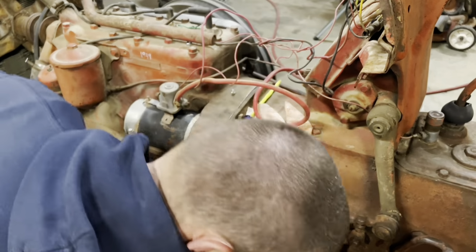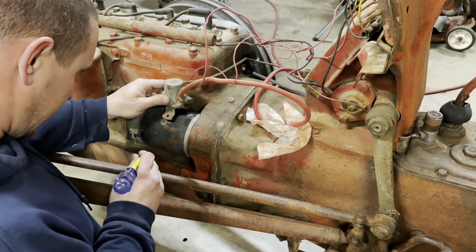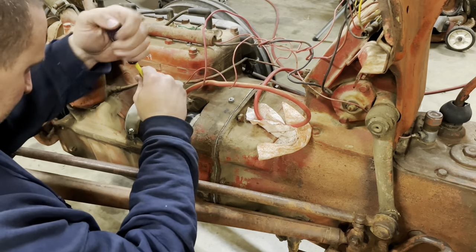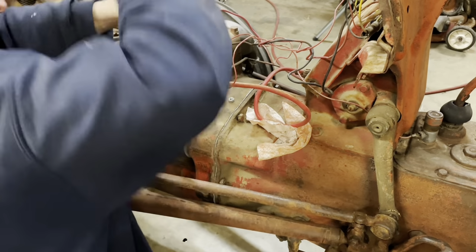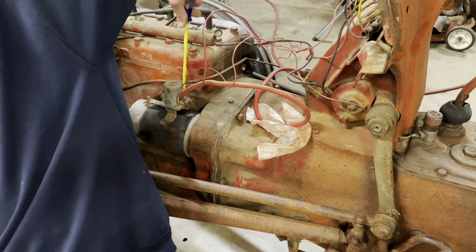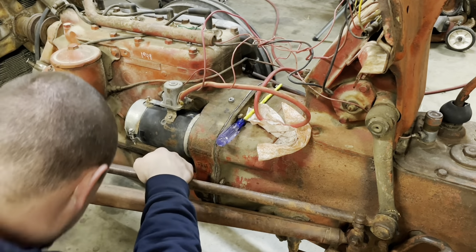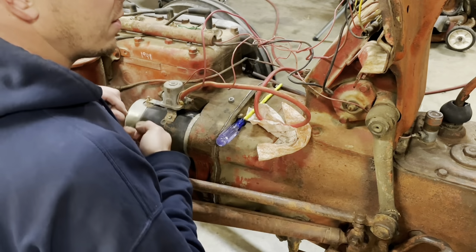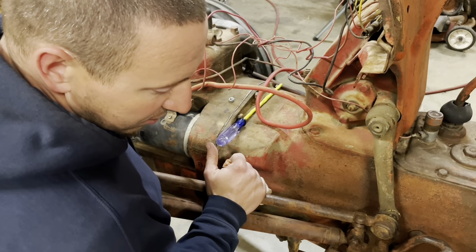Okay, oh, sorry. That nut, my screw here. Okay. Put the solenoid back on there. Barely. Okay. Another hint that this could be running a 6-volt system is that there's a big aftermarket automotive style resistor mounted up there where you can't see it. Definitely not factory.